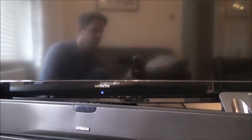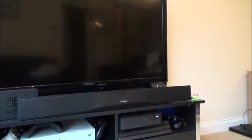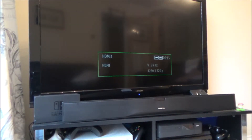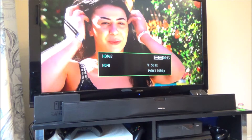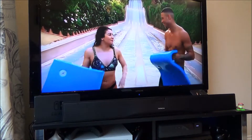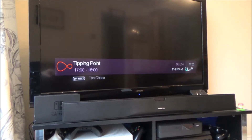There's still nothing displaying on the TV. So we're going to swap it from HDMI 1 to HDMI 2, because I know HDMI 2 was in use earlier today. Now it's in HDMI 2. Let's change the input on the TV to HDMI 2. There we go - so it's an HDMI problem and it looks like the problem is with my actual TV.